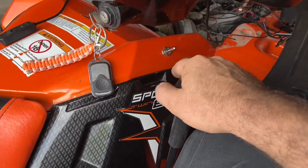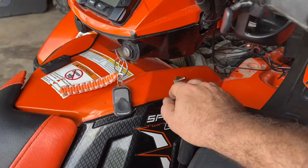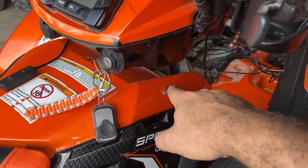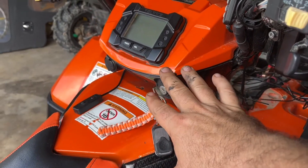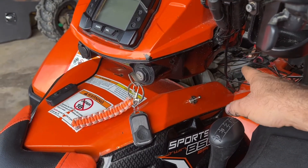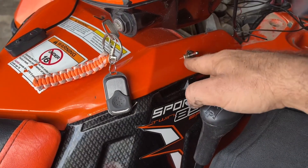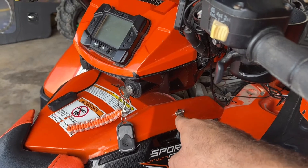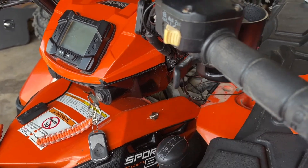The customer already tried doing this himself and put a switch in — it's not really what I would have done. I would have put a switch up here on the cowl to make it easier and more accessible, because down here it might get knocked. But we're just going to use his switch. Wherever you want to put your switch, I recommend up on the cowl — just a toggle switch. One side of the switch gets our control wire, and the other side goes to a ground source.